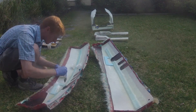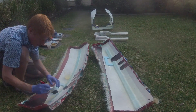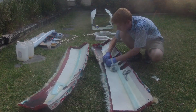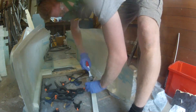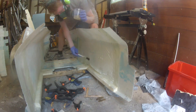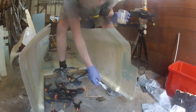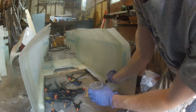Strengthening the bodywork was done either by laying extra fiberglass layers down, or by laying foam strips along the fiberglass, bonded by epoxy, then covered with more fiberglass to make a rudimentary composite. The results were mixed — it worked as a method to stiffen parts, but the stiffness was localised to the region with the foam strip. At worst, this resulted in buckling or cracking around these regions. Perhaps tapering the thickness of fiberglass might have prevented a stress concentration from forming — I just didn't think of this when I did the work.